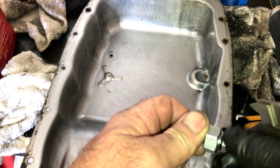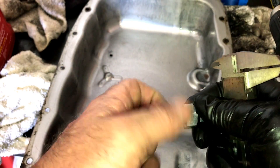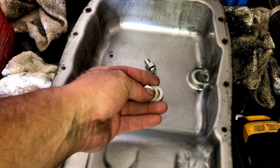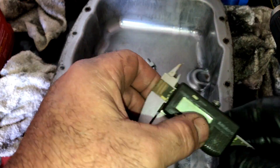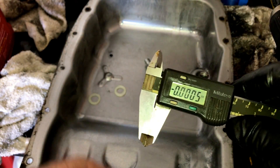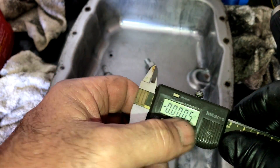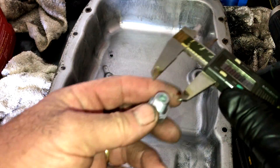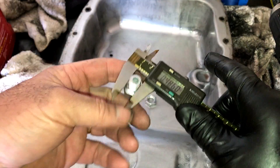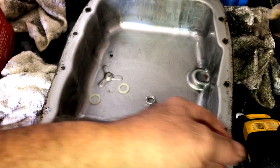You'll actually take this bolt out right here — it's got a seal on it. First thing you're going to want to do, and you can get a lot of these tools at Harbor Freight. Everybody should have a set of vernier calipers; they don't have to be digital. You want to measure this right here. It doesn't have to be exact — lock it down so you don't move it. It's 486 thousandths.